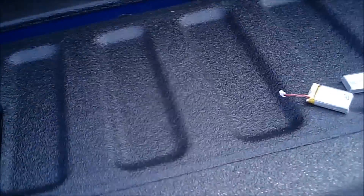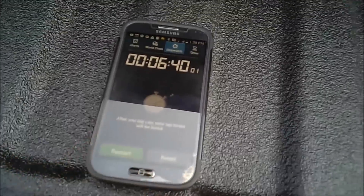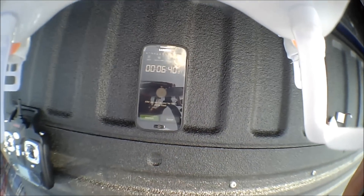The stock battery is depleted. We landed at 6 minutes and 35 seconds. It came down pretty hard, so it died pretty quickly. So there you have it — with the 650 milliamp battery you get a good solid extra minute of flight time, even with the extra load from the camera and the heavy weight.